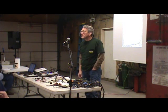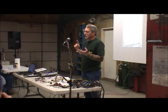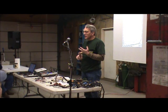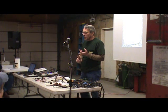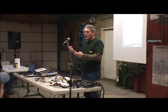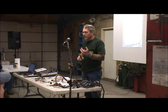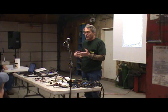Can you go through those colors? Sure. A brown is hot feed off the battery. Blue is supply to headlights. So if I come off the back of the headlight switch, I'm going to have a red wire that goes out to my parking lights and to my instrumentation cluster, but it usually goes to the cluster through the rheostat. So it'll be red to the rheostat and then red with a white tracer off of that does all the little light bulbs. Blue is off of the switch that goes to the high-low beam, and then from there I break off, it's blue and red and blue and white. And black, well, black, yeah, ground.